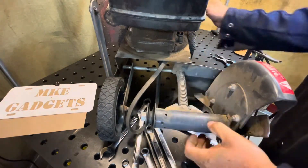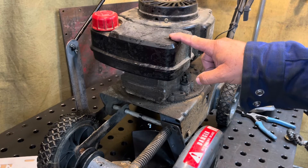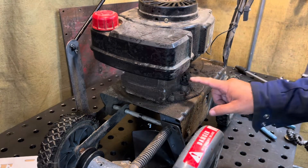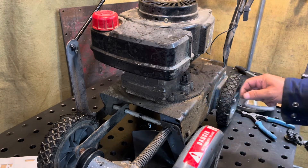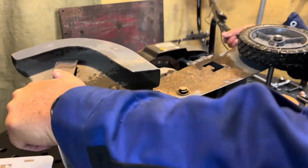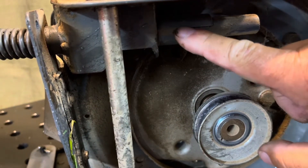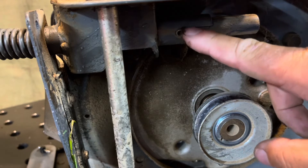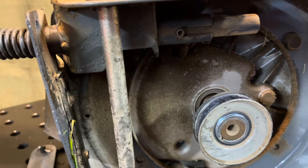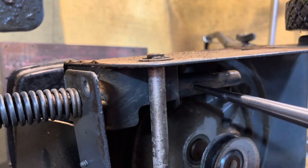Hopefully this pulls out. I just took it back outside and drained all the gas. This is the oil fill, so when you turn this you want to have that facing up so no oil leaks out. Looks like a little oil has leaked. Underneath, it looks like some kind of roll pin in there — I'm going to have to knock that out. Putting this together I'm going to have to compress this spring, and when this thing gets pushed all the way out it could come flying out.